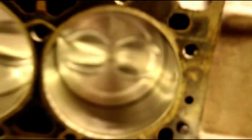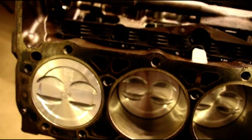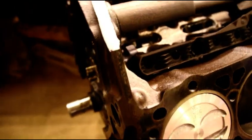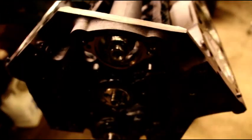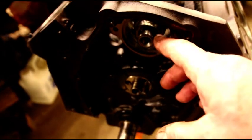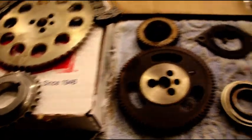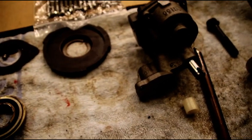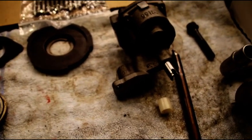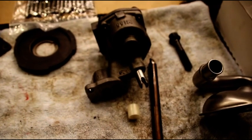This is critical when you're getting parts for these engines - a lot of places you can go wrong. You'll get your cam bearings in and can't get your cam in, or your bearings won't go in. Once the bearing comes in for the balance shaft, the whole front timing set can go in, along with the oil pump, and then we can get the timing cover on and the oil pan.